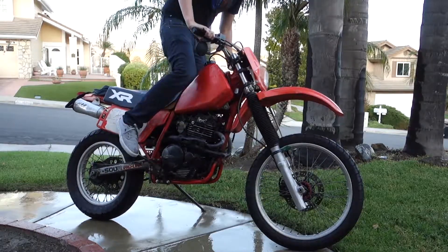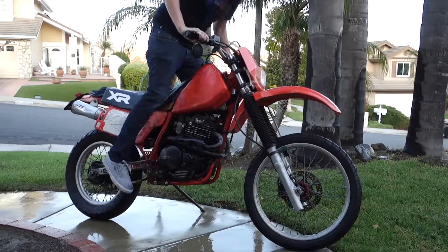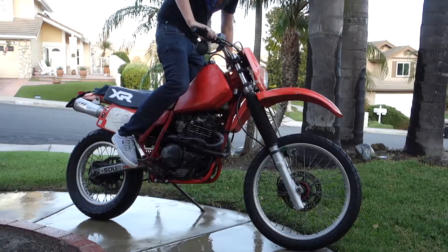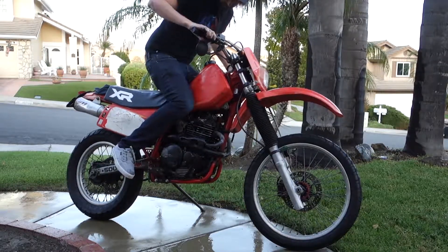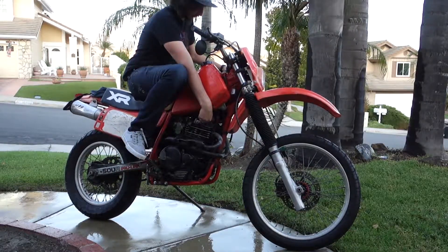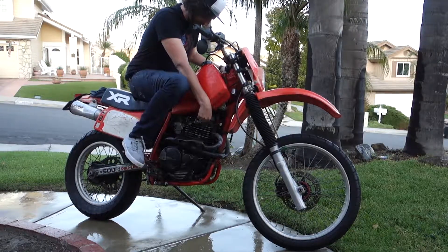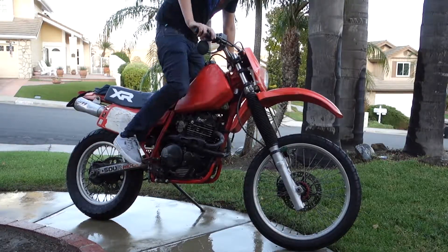I had a bunch of fear because I'd read stories on forums about people injuring their legs when the kickstarter kicks back at them. I was especially concerned because the decompression release was broken on this bike. So I was kicking it and trying to get it right below top dead center, which is why you see me pedaling the kickstarter so much — really trying to make sure it was in the right position before attempting to kick it. Because it did kick back on me once and it almost launched me off the bike. I was worried the broken auto decompressor was making it hard to start.